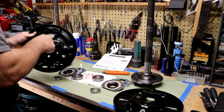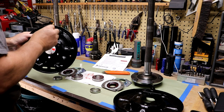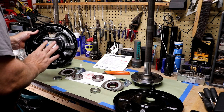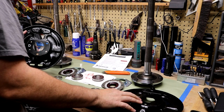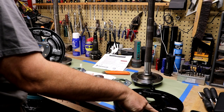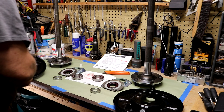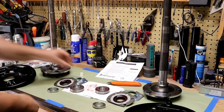The key is the hole for the emergency brake — on this side, meaning this is the driver side. The passenger is just the opposite: wheel cylinder points out, and if the hole is facing forward of the vehicle, this has to be the passenger side. You've got to get all this stuff direction-specific as well.